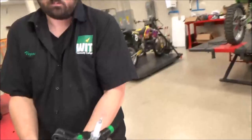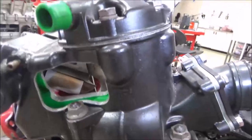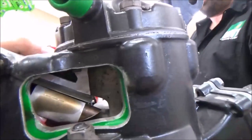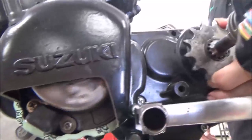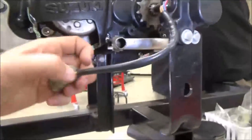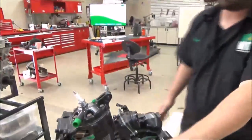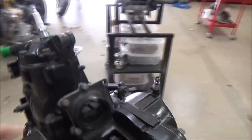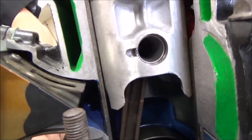Great way to learn for these students being able to have that visual and that 3D exposure. Here's that power valve cutaway — pretty cool. You can actually see it opening and closing, changing the size of the exhaust port there. Go ahead and rotate. See the ignition pickup — tells it when to spark. And our future goal is to motorize this, just haven't got that far yet, so it could just spin real slow and students could watch that. And here you only see the intake and reeds — here's a good shot, a cutaway of the reeds. See that open and close.